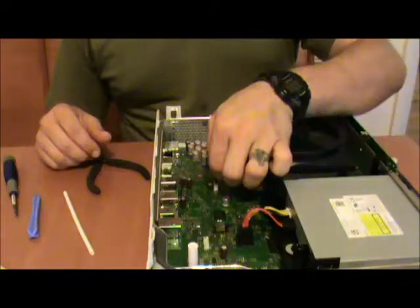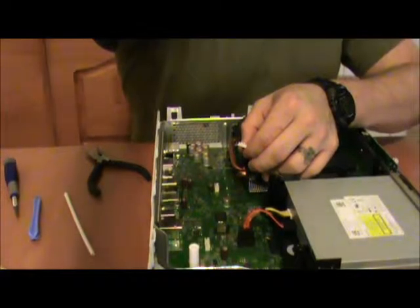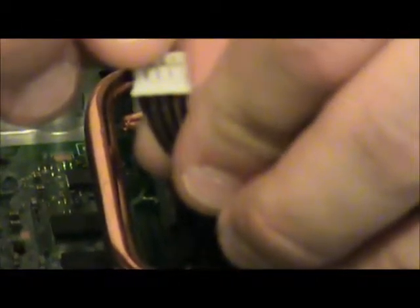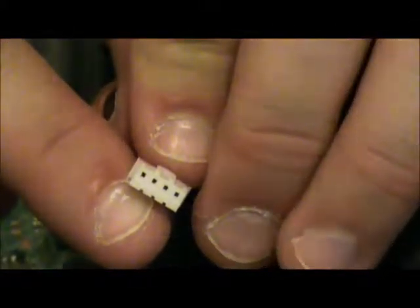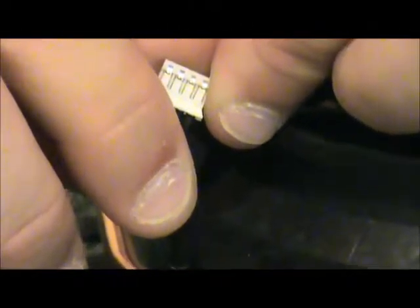After, pull out the plug for the fan. Now then, as I said previously, this fan plug is identical to the fan plug in the Xbox 360 Type S and Type E. That's generation 2 and 3 respectively. The only major difference is, as you can see, it's all black, it's not colored. So we have to be real careful and play from memory. You gotta pay attention to where your teeth are. You got teeth up top, and then you've got your shiny teeth back here.